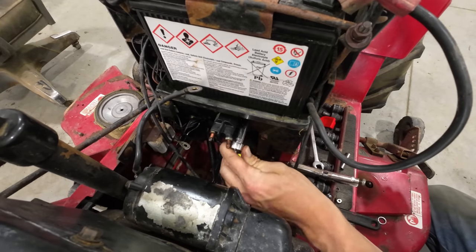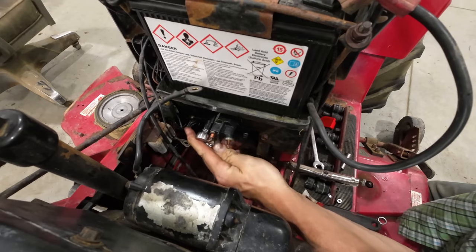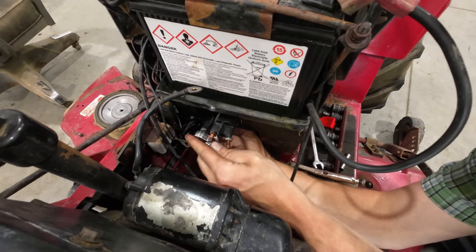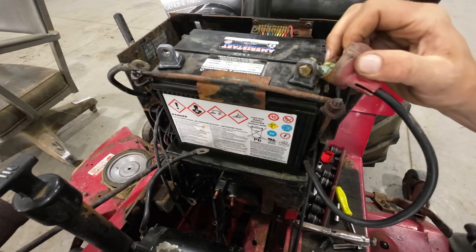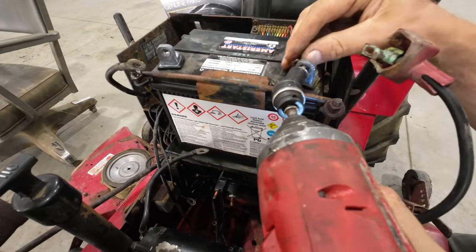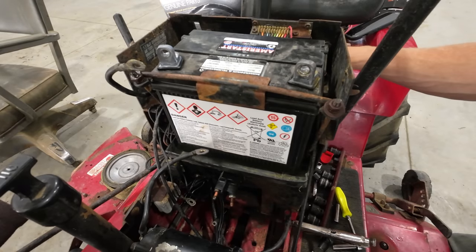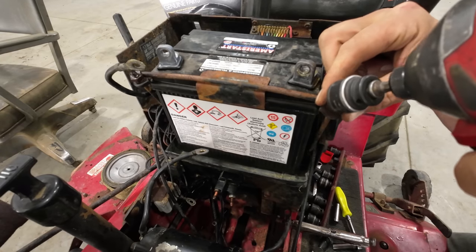No. This stinking thing has nuts on the backside. You gotta hold the nuts. Unbelievable. Why would that be like that? Well, now I'm irritated. Have to take the battery right back out because I'm paying my stupid tax. Turns out the solenoid cannot be easily changed without removing the battery tray. Or at least I presume the battery tray comes out to reveal the solenoid.